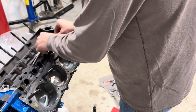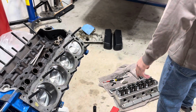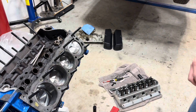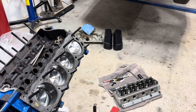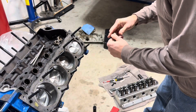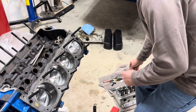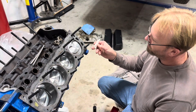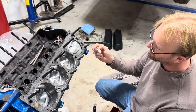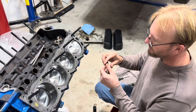Either that or you need to put some checker springs on your cylinder heads. I don't really want to do that — I'll leave the heads alone and not make any changes. Head studs are in; I didn't video that. The bottom row of course has this Permatex high temperature thread sealer — put that in each one of those. The top five just get a light oil.